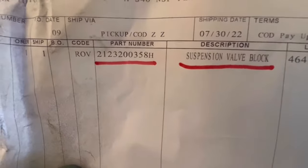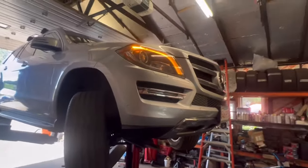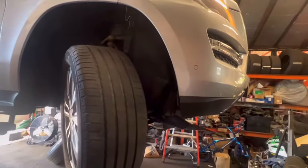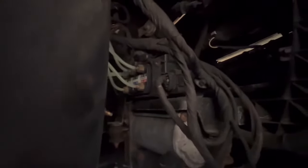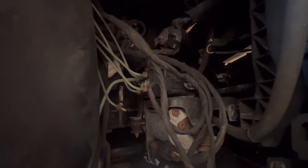It's actually the same part number from Mercedes, and I get it aftermarket. Not only this Mercedes — any other Mercedes, they all have the same design: the valve and the pump. Most of the time the pump is working but the valve is not working. So if you hear the pump working, don't bother replacing the pump — just change the valve. Every vehicle has a different valve design. For this G-Class and GL Mercedes, keep watching — we're going to replace the valve. It's two bolts.